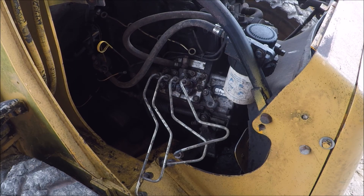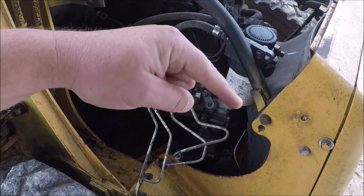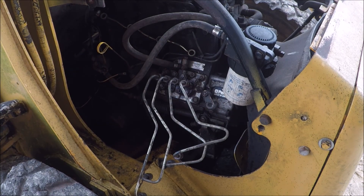I'm going to go ahead and take that adapter out. I think that proves to me that the head's still good — I don't have pressure loss. Combustion should be working fine as long as those injectors are good. Well, if this video was helpful, please give it a thumbs up, subscribe down there with the little red button in the corner, and until next video, y'all take care.